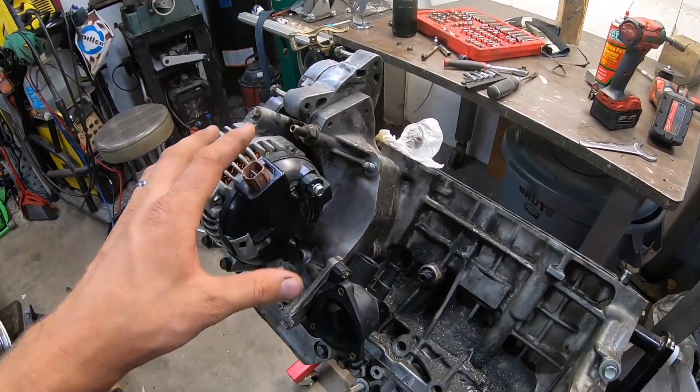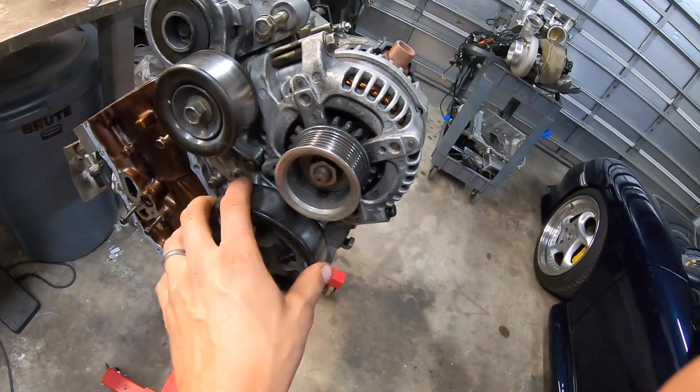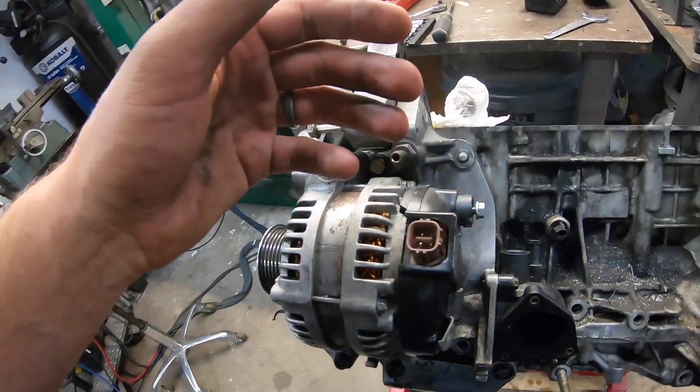Welcome back to the Bayside Fabrication YouTube channel. I'm scheduled to pick up a new motor on Tuesday — there's a JDM importer in Orlando — and we're going to get a nice low-mile JDM motor. Fingers crossed it's going to be a solid unit; if not, they have warranties. It was $400 more than this junkyard motor I bought. I'm pulling off all the accessories because the JDM motors are different — the alternator bracket and pretty much this whole assembly is different from USDM versus JDM setups.